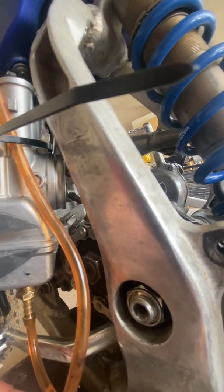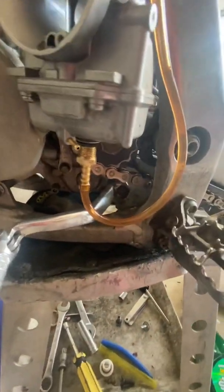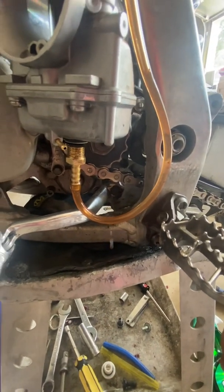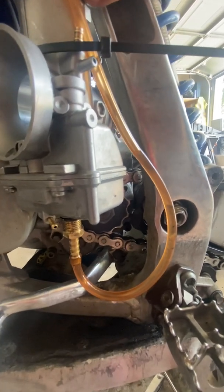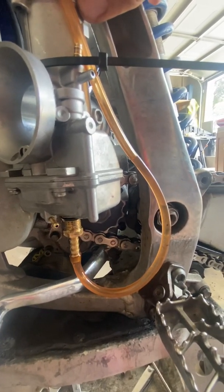So if I measure off the mating surface — this is ten millimeters, so I'm right about there. I can go ten and a half, so I'll probably just live with that. I'm at ten, so I'm within tolerance. The dripping you're seeing — if you've got something coming out of here even when it's upright, then you've got a problem, because you can't be in spec and have your overflow venting fuel. So you want to make sure this thing is upright, and as I look at it upright I'm definitely within that nine and a half to ten and a half millimeter range. I think I'm good on that side — that's how you set the float level on these things, and it's a different monster.